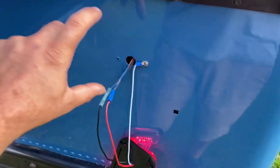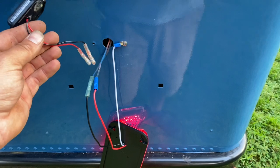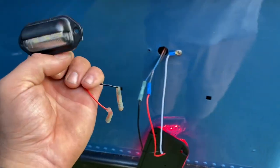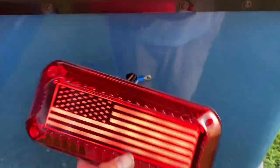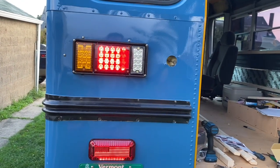Just out here rewiring because I bought these license plate lights and made a huge brain fart. There are two wires coming out of where these lights were — red with an open underneath so it shines down white to light up the license plate. For whatever dumb reason I thought it was positive and negative, hooked it up on the driver's side, then showed Serene the brake lights at night. Pressed on the brakes and I noticed the license plate light went out, realizing these were running lights AND brake lights. So whenever I pressed the brake I was giving power to both leads to this LED license plate light. Went ahead and picked up these American flag lights — one of them has a license plate light on it, so that's what I'm working on today.